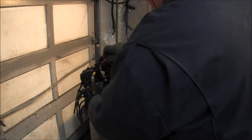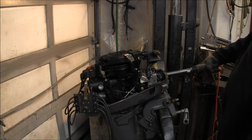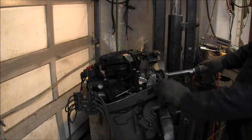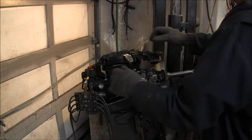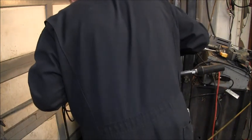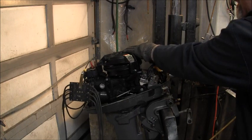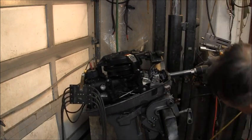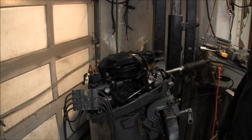that I can see if I can get. Yeah, maybe right there. That might hold it right there. Will that work? Yeah, hey, that might. So, let's see. We are in neutral. The switch is on. I think I seen one plug fire. Oh, I thought I did. What's up with that now? Let me make sure I'm on that good. Well, where can I work it? There's a piece of something. I'm trying to find a place to hook this. There, let me try that. I don't see no spark. I did for a second. Let me make sure I got this. Well then. We got no spark.